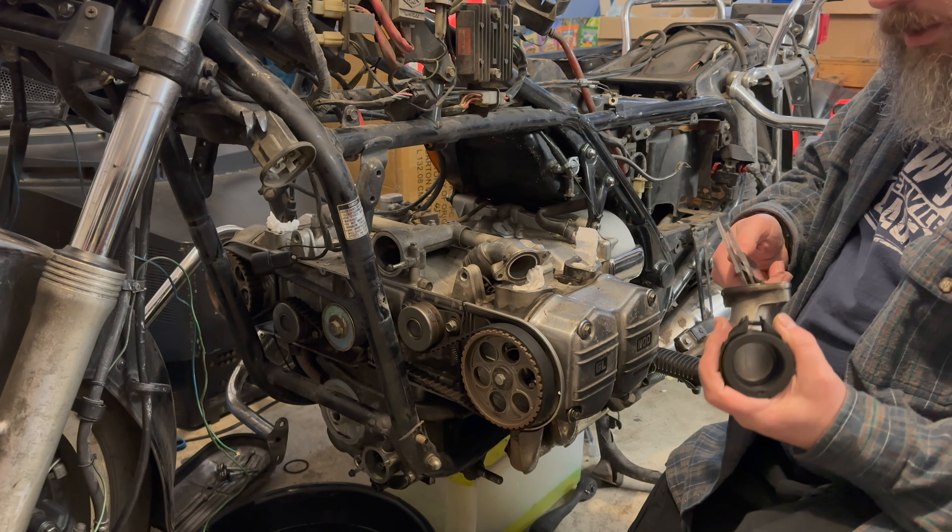Good afternoon - I've got a rough draft of the intake manifold. If you know these bikes well enough, you can already tell I made a mistake: the cylinders are offset because they're offset on the crankshaft, and I didn't do that with my runners, so these should have been over a little bit. I'll have to redo it. But this is a very rough draft. What I did in the design was a half-pipe shape - flat on top but half a pipe. The throttle body bolt pattern is a 4x100 or something close to that, and the runners are the right size - they just fit on there, in fact they're a little loose and might need to be bigger in the next version, although they kind of shrink in the end so it might be okay.